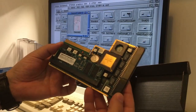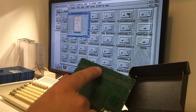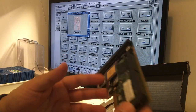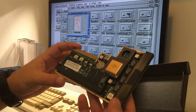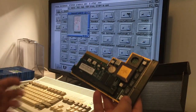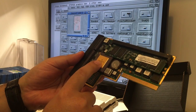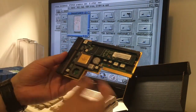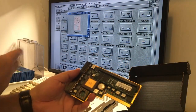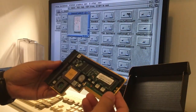This is awesome. Here we can see it says Blizzard 1230 MK4 — back in '95, Phase 5 Digital Products. The condition of this one is just amazing. It has 64 megabytes of RAM installed — you can pull this out and install 128, but 64 is more than enough. It has a Motorola 68030 running at 50 MHz. This is a 14 MHz computer boosted up to 50 MHz, plus it's the 030 instead of the 020, so a really nice boost. You also have the option to install an FPU.